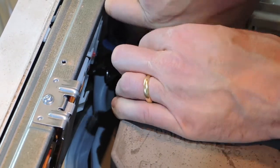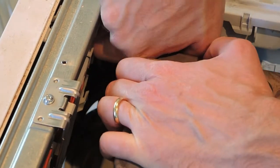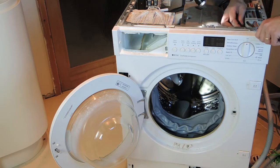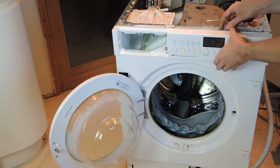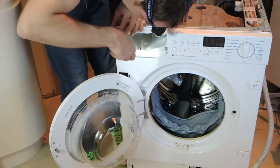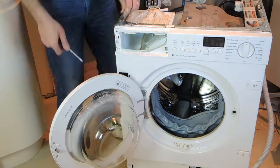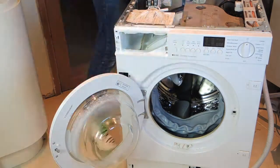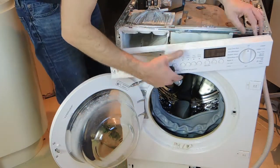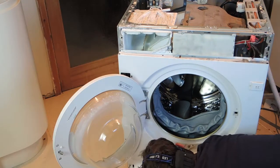This is the top front of the washing machine and here I am removing the clips to the soap feed between the soap drawer and the drum. Now I am removing the screws on the front panel — the control panel with all the electronics. I did get caught out on that little clip on the side: it actually slides up rather than comes forward, so be careful with that. Remove the remaining screws and the front panel should come off; just need to disconnect the electrical connectors.